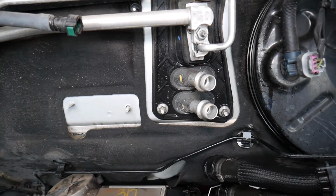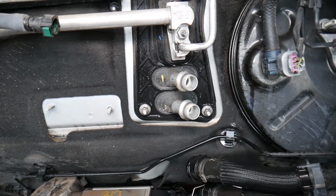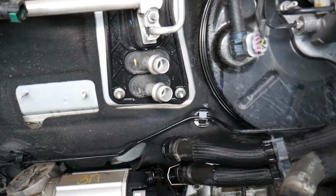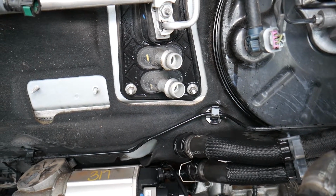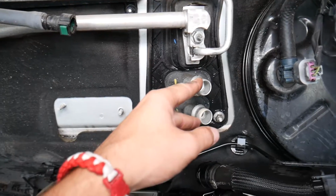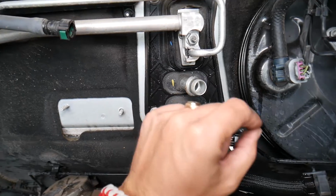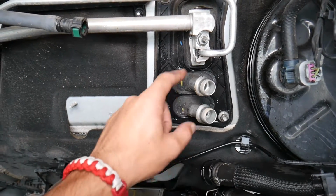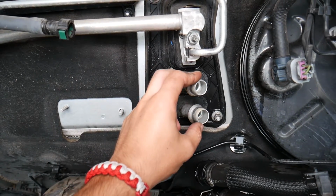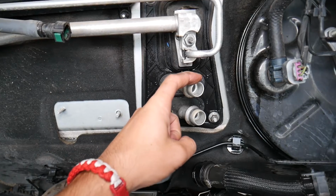Now, we have a video on how to diagnose that and how to know if it's bad or not. But what you usually do is disconnect the hoses somewhere, so you need to find a place where you can disconnect them. After you disconnect the hoses, we'll do it directly at the heater core. You're going to get a garden hose and have a steady flow going through the heater core. We will actually use a power washer, that's even a little bit better. Low pressure power washer, you can find the link in the description of the video below.